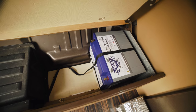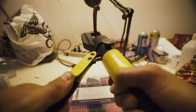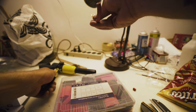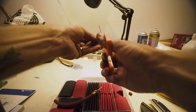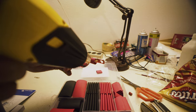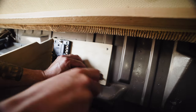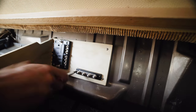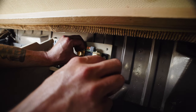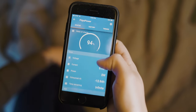While Amy was away for the last week visiting her parents in North Carolina, I set about the task of figuring out how to wire the van for that much power. We had to lose a little bit of storage underneath our bench seat because there was absolutely no way the 200 amp hour lithium batteries were going to fit in the stock compartment. We wired them to fit underneath the bench, and with this newer, better, smarter system came a lot of accessories — most importantly a Bluetooth-connected battery monitor that shows in real time exactly what's going on: when it's happy, when it's not, how much we're charging, and how much we're pulling.